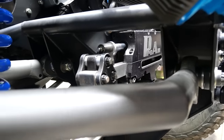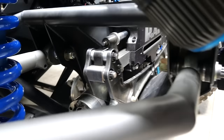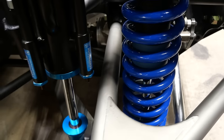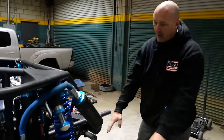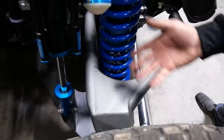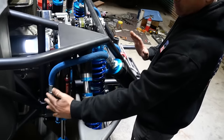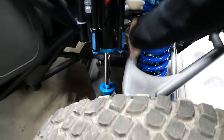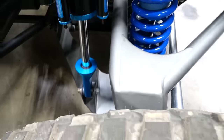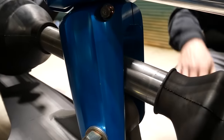Once you got this laid out, you started piecing it together. Built the whole entire bulkhead on a workbench, got all the geometry correct, then figured out how to put it onto the actual vehicle. It's straight up like an RC car. Even the tubing on this is huge — I went strong with the tubing. That's technically an A arm. I put the coilover on the inside to keep everything packaged — I needed it all to fit with four-wheel drive, the steering, clearing everything, getting the big block out. That's why I put the arm through the center, and that's why I put the coilover right over the axle. I used King's clevis mount to run the axle through the center of the shock, which most people don't do, but I was able to pull it off and get the geometry to work.